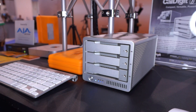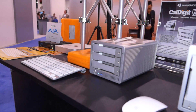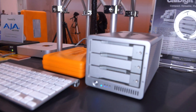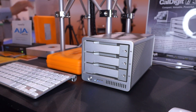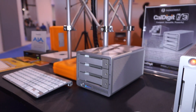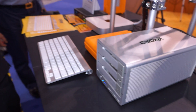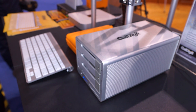The T3 supports SSDs and hard drives up to 12 terabytes with regular hard drives, or over a terabyte with SSDs. But the unique function is that you can actually mix and match SSDs and hard drives. For example, you could put two SSDs in a RAID 0 as your scratch disk and then have a 4 terabyte drive at the bottom as a backup. Or you could have one SSD as a scratch disk and then have two 4 terabyte drives in a RAID 1 to mirror your data in case you were ever to lose the hard drive.